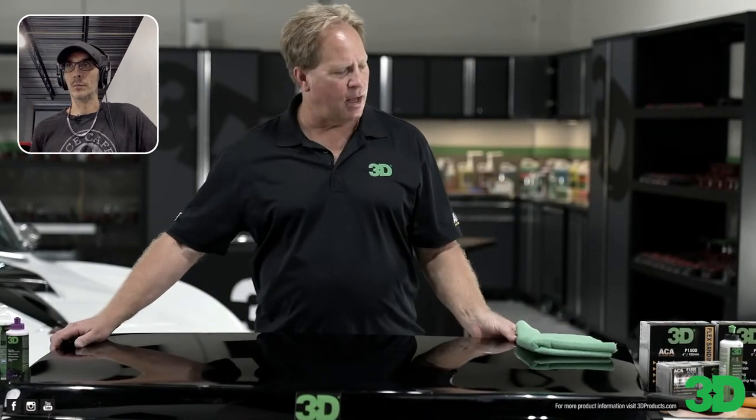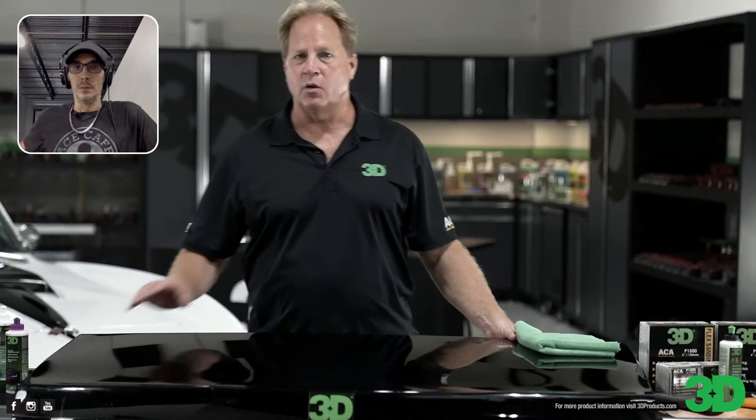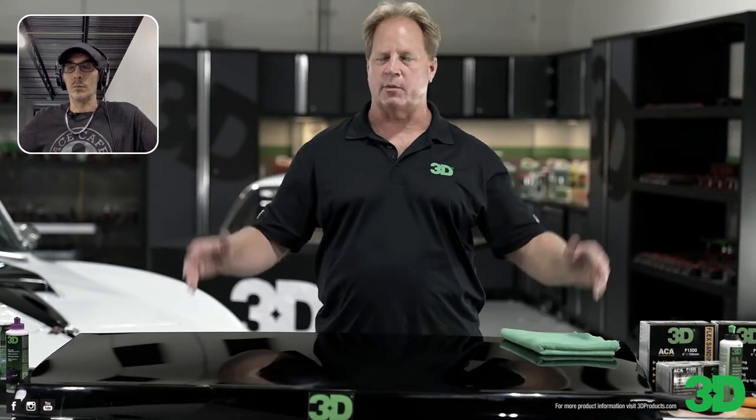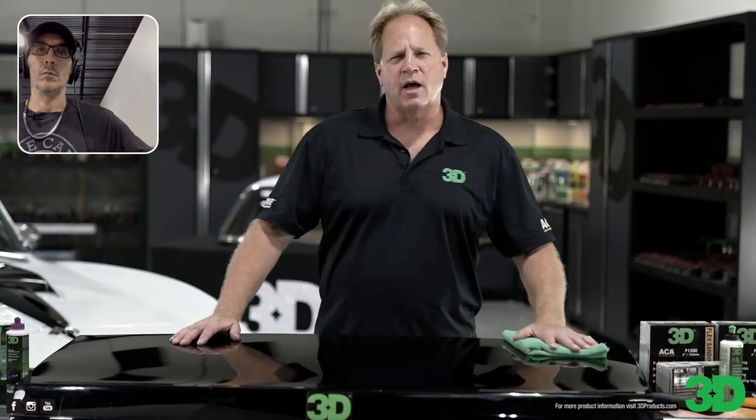But here's how I think about it. You're about ready to knock that speed bottle over. In my life I've done a bunch of rotary-only details and put out the pictures in full sun on the internet for everybody to see. But the way I look at it is, why take a chance? Just go ahead and do the last step with an orbital. The orbital action has a way of working out the hologram scratch pattern, so it's just not going to be a factor. It's not going to be an issue.